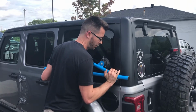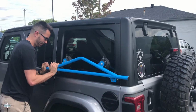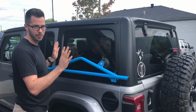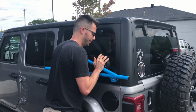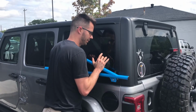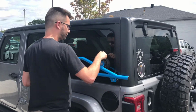And you can pump it until it won't pump anymore. And then go to this side, do the same thing, push on it and pump it until you can't pump it anymore, okay? So now it's partially attached. Come over here, put pressure on this vacuum lifter, either one's fine, but put pressure on and pump this finger pump and it will start to attach to the glass. And just go ahead and pump that one up until you can't pump it anymore.